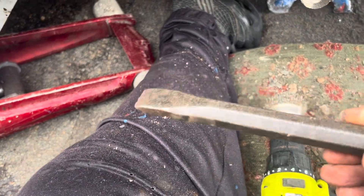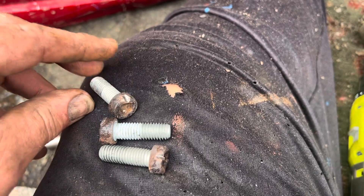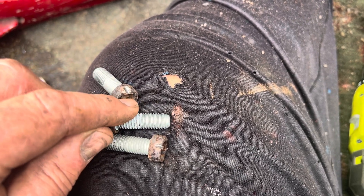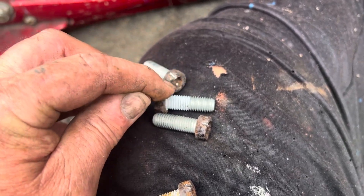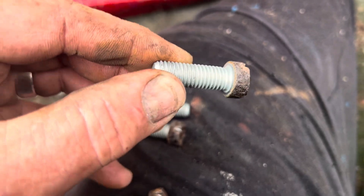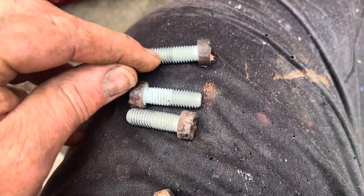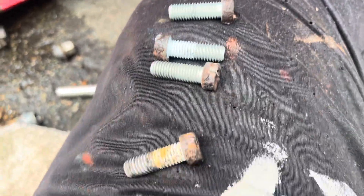Here's mine — which I believe is a genuine Snap-on one, I've had it since I was 18. On all of them, just like an impact gun, you hit the outside of them because the actual torque of turning them on the outside is better than on the inside. That's the bit I use to get them off — I think they're a T45 or T50. Always first give a couple of taps around to break the sealing. These are non-genuine bolts — genuine ones are blue, these aren't, and they've got no seal on them either. I'll put a little bit of loctite on them just to lock them — I only use the semi-hard green stuff, not the red stuff.